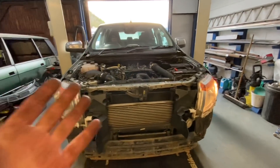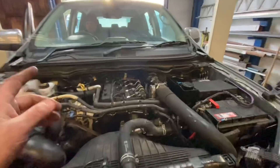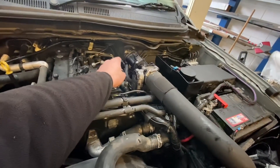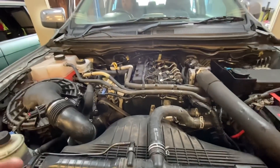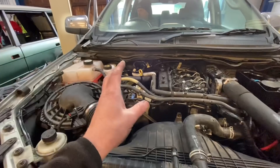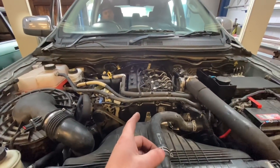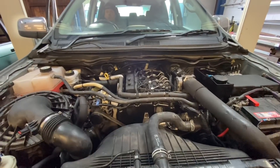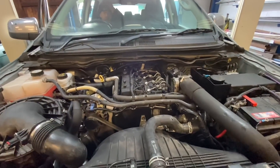Completely raw and live — we've just finished and straight away, as soon as Chris turned the ignition on, we noticed a tiny diesel leak where the spillback pipe just needed a tiny push on. Chris said we've got the oil in there, some water in it — it's all going to want topping off once it's run up. He did pre-warn me it's going to make a bit of noise and be a bit tappy until it's fully primed.